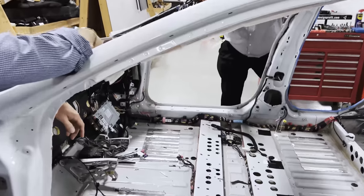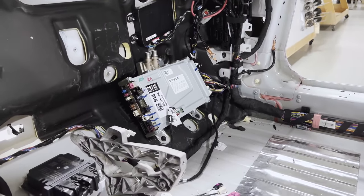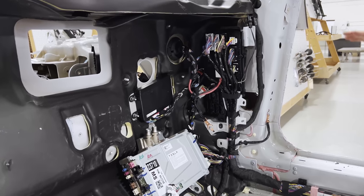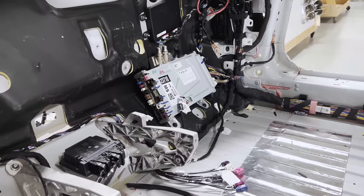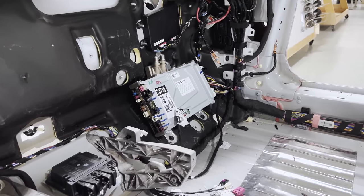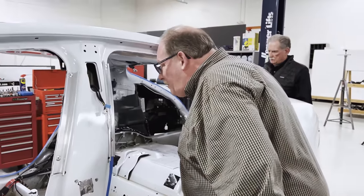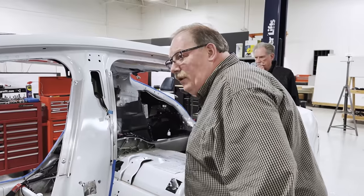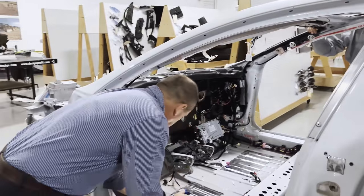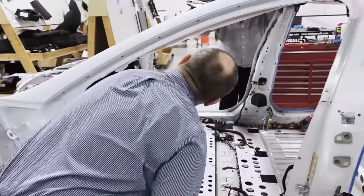The autopilot board is very similar, if not identical, to the Model Y's autopilot board, but the MCU portion is brand new on this box because it has to deal with additional screens — there's a graphics module built into it. We'll get more into that once we get it torn down. Also, the MCU used to be integrated into the center stack, and now it's standalone — similar to the Model Y and 3, but moved out of the center stack display housing.